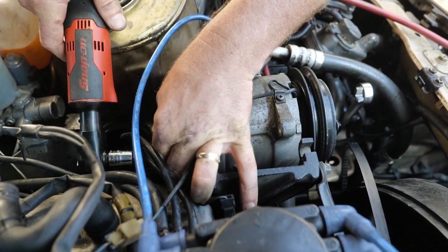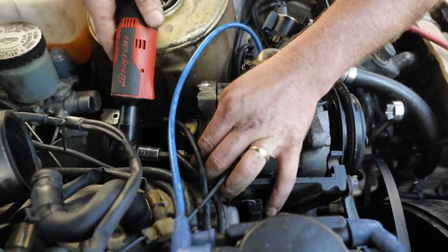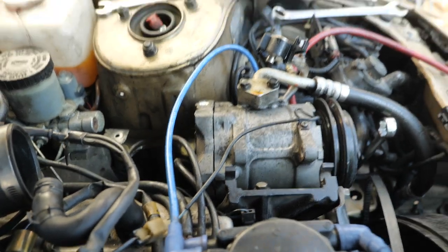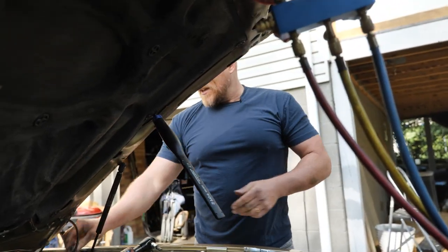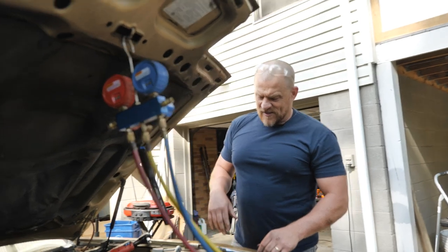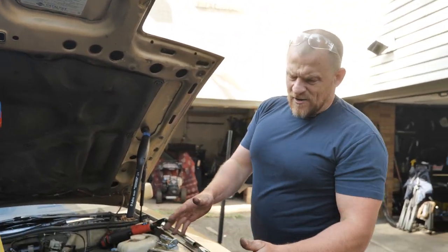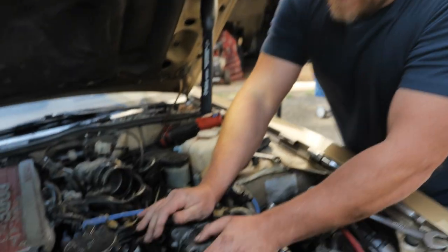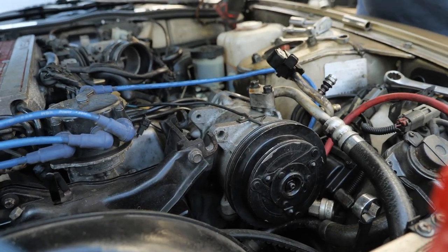And think about how south this job went. You fixed a leak on the condenser. It lasted one day. It came back. You found a line that was leaking. Didn't find any other leaks. You changed that line. We had at least 3 hours labor in that. You're done with that part and you say to the customer, I'm sorry. You need a compressor now.